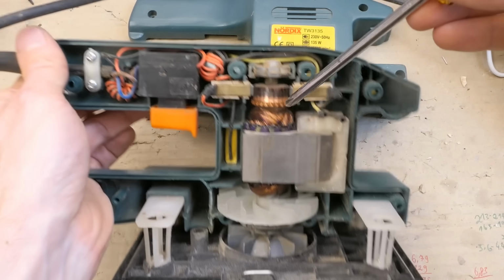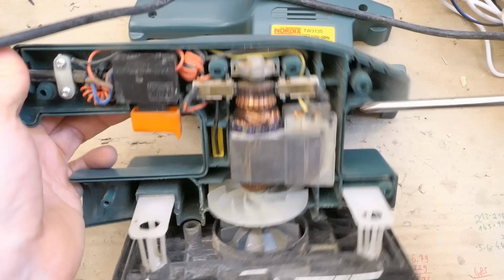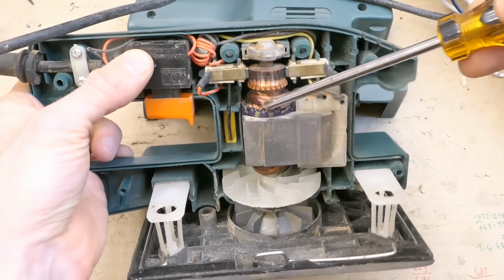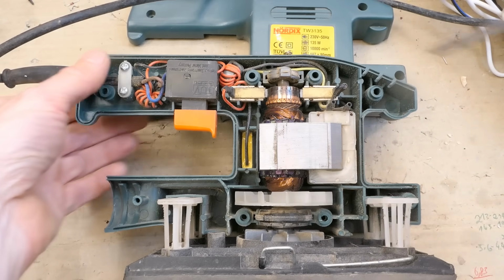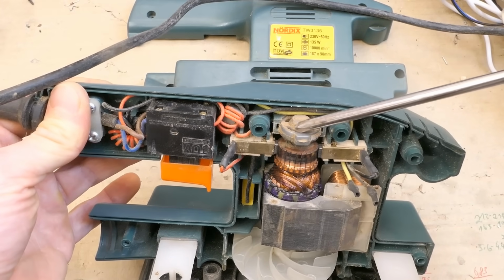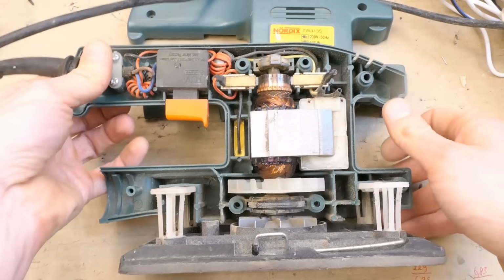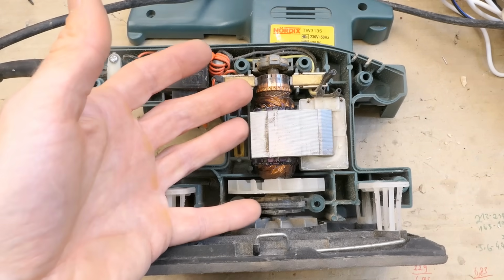And typically it's the rotor that shorts, not the field coil. I guess the rotor is actually exposed to more spikes and also to mechanical stress. And of course it doesn't have ball bearings, just sleeve bearings. These also wear out. These things are really not designed to last very long. It's more for a hobby than some professional use.